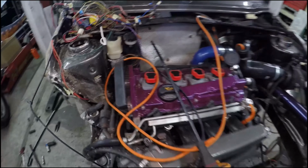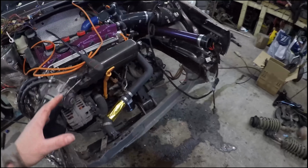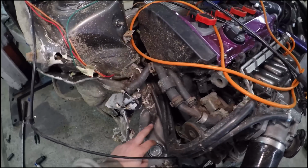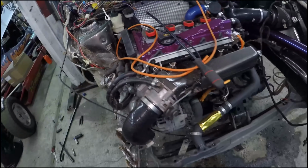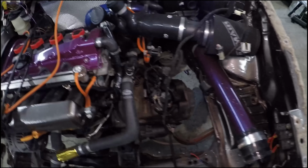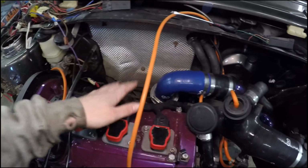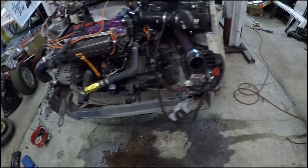I wasn't expecting to crash it and have to rip it out again. So I've got to pull all the wiring back for the car, undo the plumbing on the engine, and pull the engine out. Now this could be a bit of a challenge at the minute, because the chassis rail is currently pushing into the timing belt down there. So the engine can't just come up, it's got to go sideways. But obviously the gearbox is already there at the chassis rail, so we're going to have to try and wiggle it out a bit. But it should be fine. So I've got to unmantle that, undo all the wiring, do the downpipe, and then that should be the engine ready to come out. That's what I've already removed.